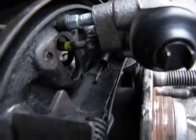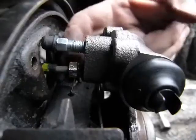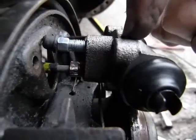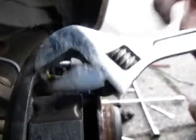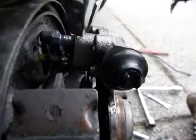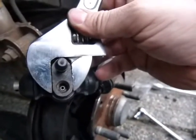I just need a little bit of elbow room here. Now, to remove the brake line — this one down here — from or attach to this wheel cylinder, I usually use this crescent wrench and put it on like so. You can see it's grabbing that oval part of the wheel cylinder. I'll show you on this one too. That's how the wrench is on it. So that was the old one, this is the new.